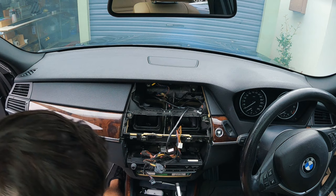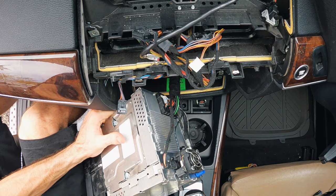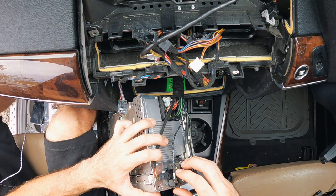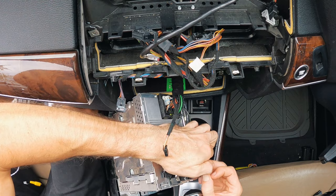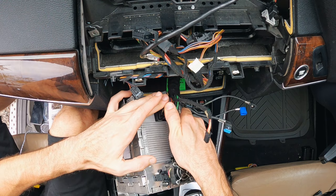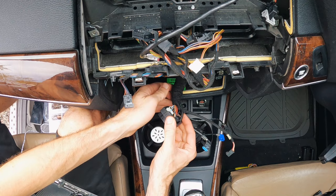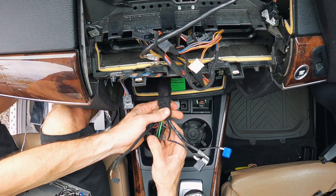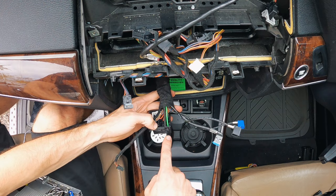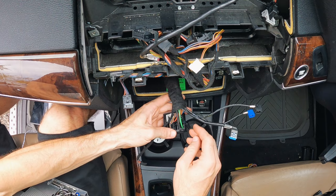There it is. Hopefully you can see the back of the unit from up there. I'll pull all these plugs out so that we've got better access — and then the big one. She's out. This here is the car's factory harness. In the Xtrons manual it says that this green wire is the fibre optic cable, which needs to be removed from the car's factory harness and then placed into the Xtrons adapter, so that when you plug the adapter in, it can still feed that into the unit. I'll pull that out now — it looks like it's just a little tab holding it in.